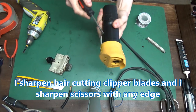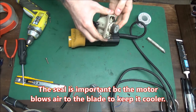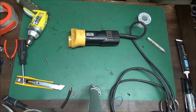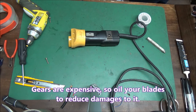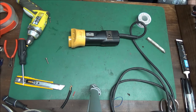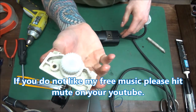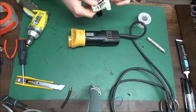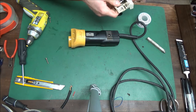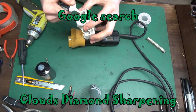Put your seal back in or it's going to squirt air out of the shroud here — you want to make sure it doesn't do that. Now I'm going to clean this gear. Here's the head all cleaned up. I cleaned the gear and re-oiled the bearings. You want to do this or you'll run into problems and it will be really noisy. A little lube around the gear.